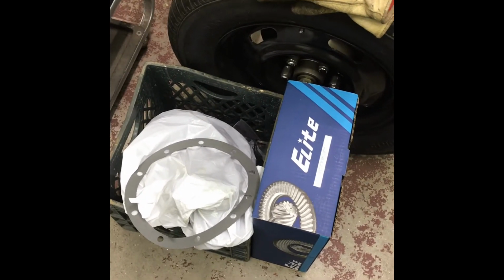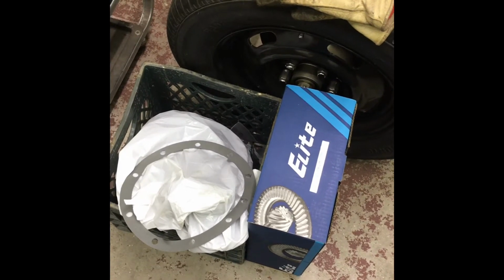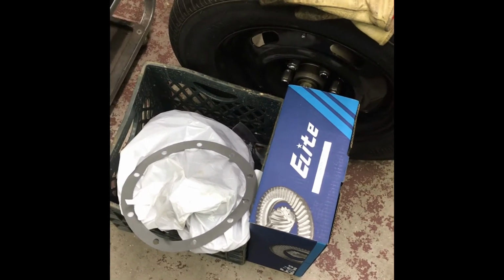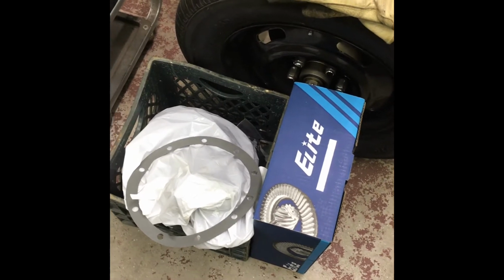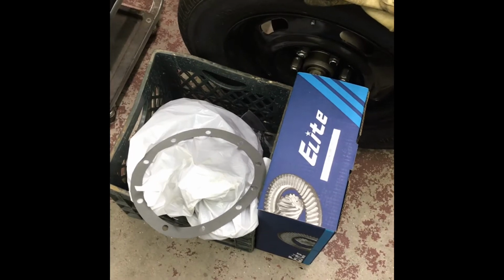It was easy. And in this case, the bearing holds the shim. The shim is under the bearing on the inner pinion bearing, so you got to keep taking it off if you're wrong. But in blind faith, I went ahead and followed the instructions, and it worked out.